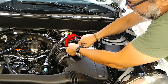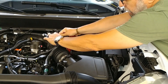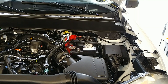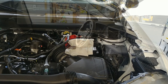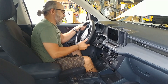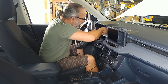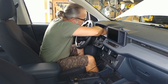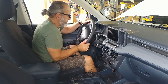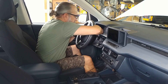The first thing we need to do is disconnect the battery. As a cost-cutting measure, Ford didn't give us two extra inches of battery cable, so after loosening the terminal — they're on pretty good — the best thing to do is to prop something under it, or better yet use a large zip tie to keep the terminal away from the battery. With the battery disconnected, go inside the vehicle, put the key in the ignition, and turn the top of the steering wheel to the nine o'clock position. Insert a small thin flat screwdriver into the three-eighths opening on the back of the steering wheel, almost directly behind the switches. Insert the screwdriver pointing up and pry down to release the airbag clip. Then turn the steering wheel to the three o'clock position and repeat the process to release the other side.